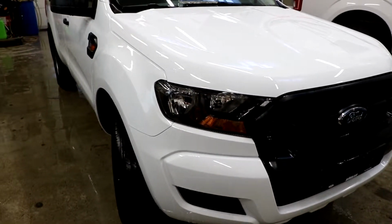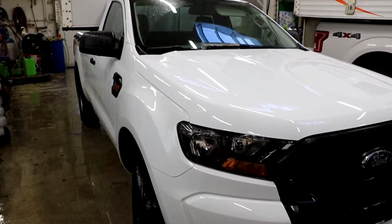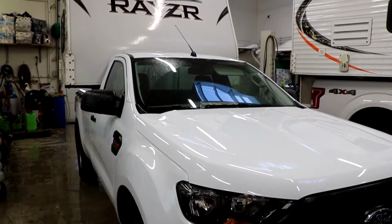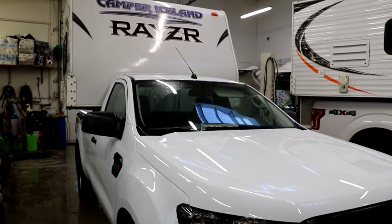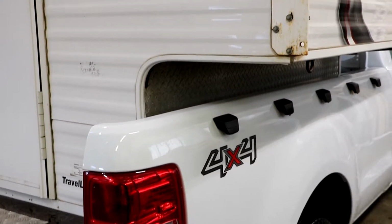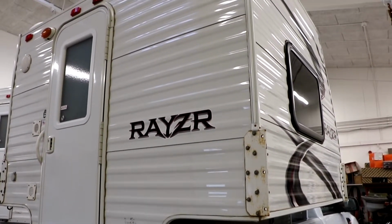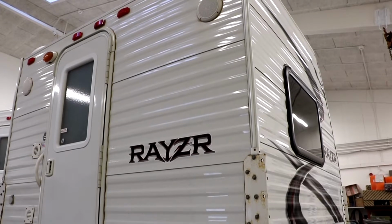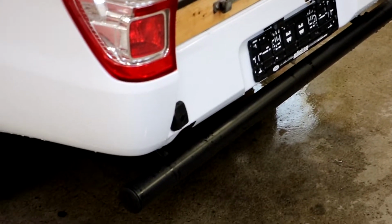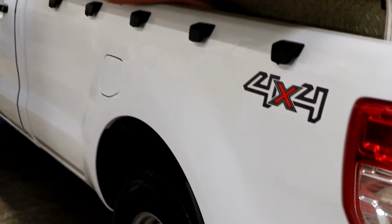In this video you will learn how a motorhome works. There are two batteries inside the vehicle. The first battery is for your engine and the second battery is for the camper. When you start the engine, your first battery will charge, but also your second battery will charge. The camper battery will never take energy from your engine battery. So if you waste all your battery in the camper, you can always start the engine. In doing this, your second battery will charge again.